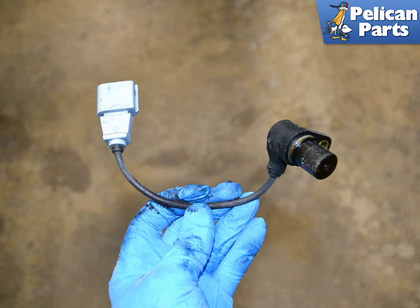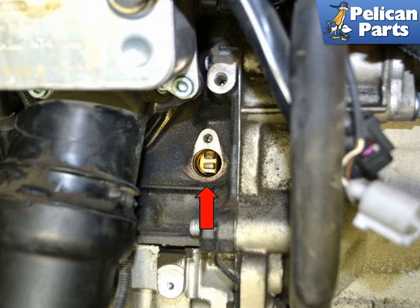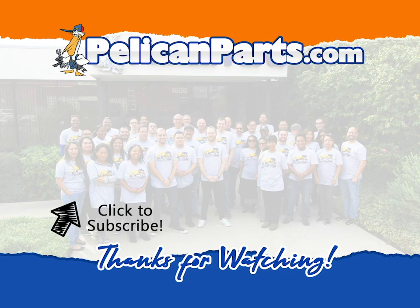This image illustrates the sensor out of the vehicle. Make sure the area around the mount is clean and level before you insert the new sensor. You can see the ring (red arrow) on the flywheel that the sensor takes its reading from. Installation is the reverse of removal. Be sure to subscribe to our channel and check out another video in this series.